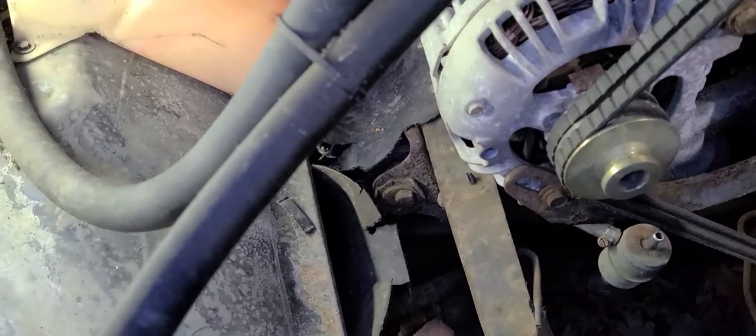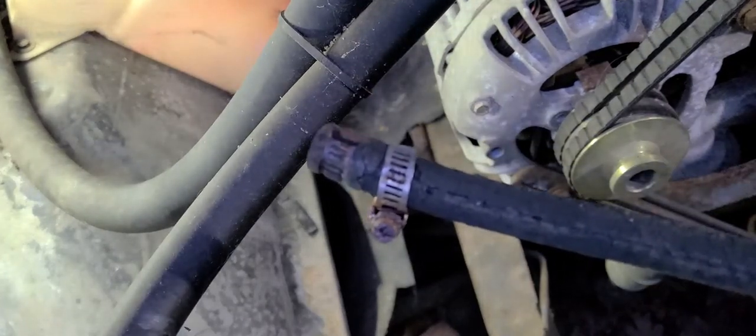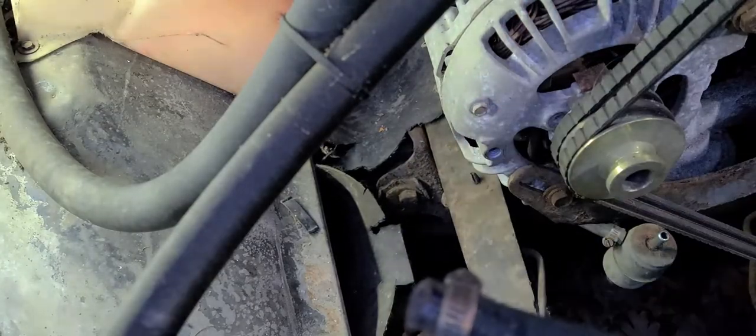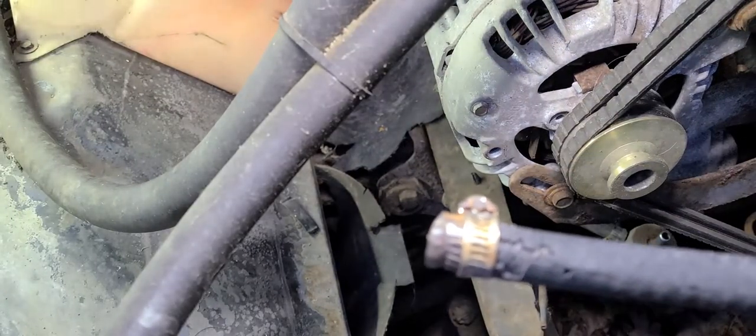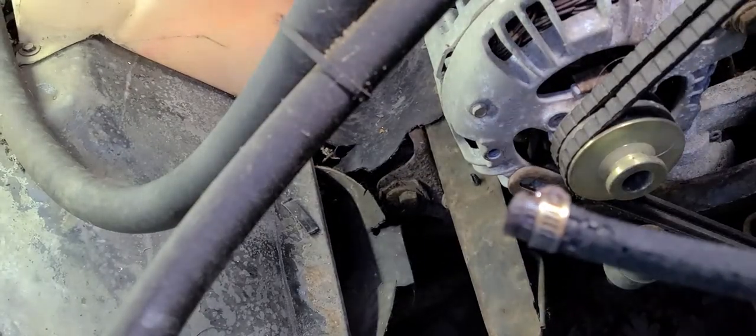Now I'll show you something about how bad this hose was. While this hose ain't under a tremendous amount of pressure, it does have some pressure on it. A lot of carburetors like to operate with like five or six pounds of pressure; some are happy with as little as three or four pounds. But look here — see the rubber chunking off? It's literally just chunking right off. Really, really bad. See, the outer coating of the hose is just flaking right off.